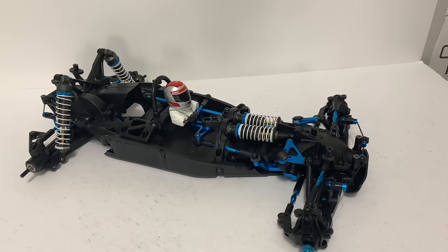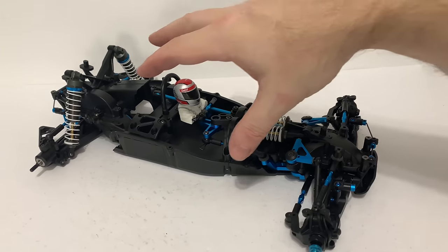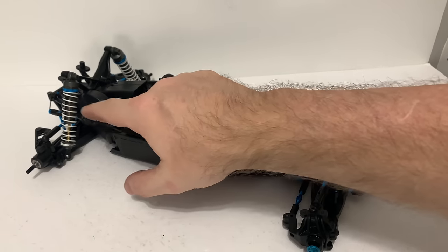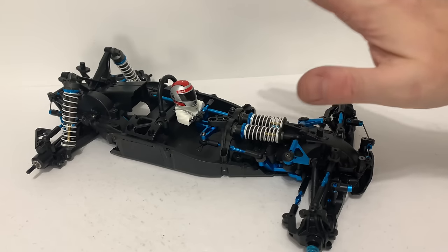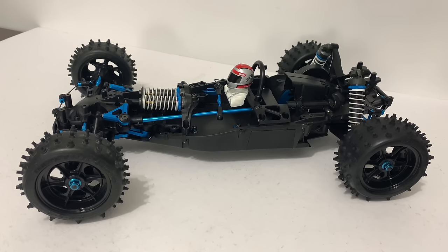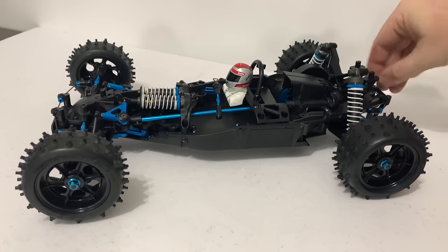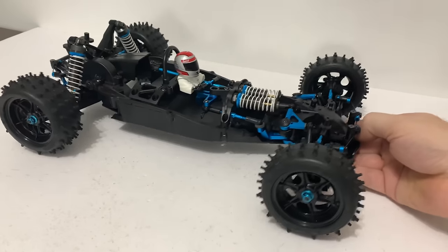All I'm going to do now is keep the car sitting slightly lower. I've already fitted internal spacers in these, and I've got some adjustment here I can slacken off to lower the front end. But I'm going to drop the rear end by another 5mm either side and then match it at the front, and then the chassis is pretty much finished. That's a 5mm internal spacer in the rear shocks. Still quite a lot of clearance — it's not like it's on its backside. But it's more how I wanted it, because it's been sat on the shelf for a while and every time I looked at it, I thought it was too high. We've still got plenty of suspension movement on the back and the fronts.